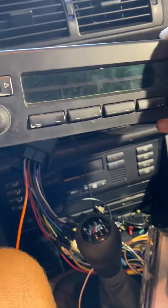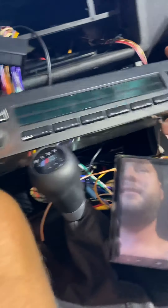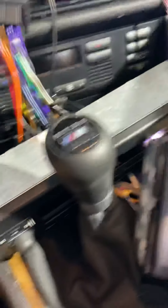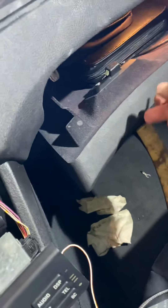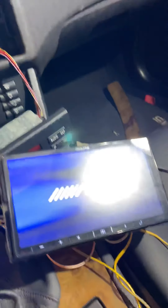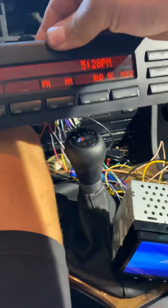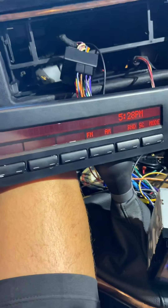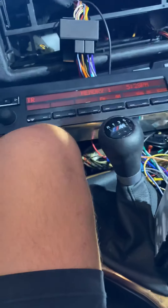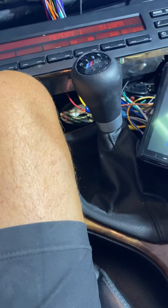Moving to the front — you're also going to keep what they call the mid deck. Basically this is your DSP unit, you'll see 'DSP' on it. You're going to keep this. What you do is take this wire, attach it, and feed it into your glove box — it's a bit big and bulky but it fits. If I turn the system on, everything kicks on and the whole system is still operating. You're retaining the entire DSP system, which is the best workaround with the least amount of work.